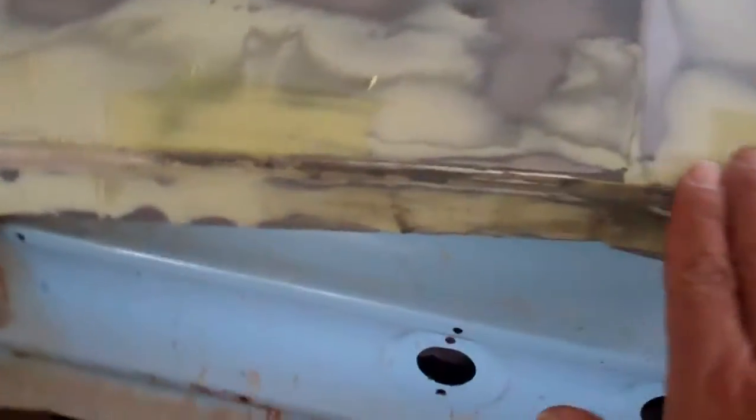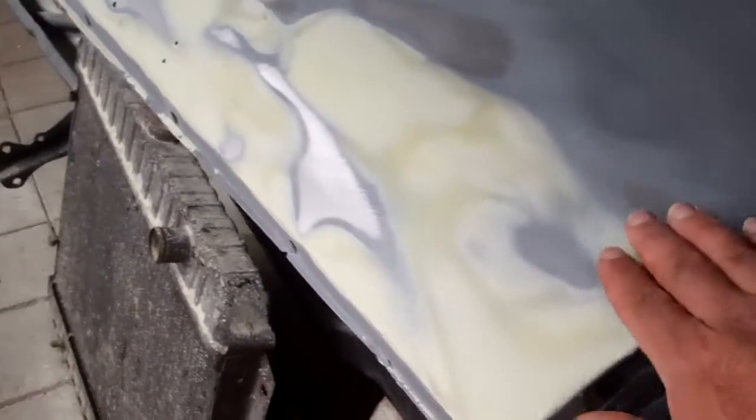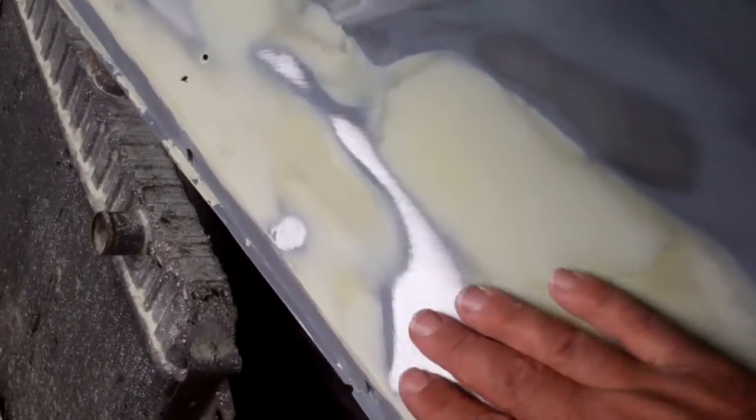So here's where it's up to. This is about the third layer of body filler that I've put on here, so I'm just working it all in and as I find areas that need retouching I'm just putting small areas of body filler in there to get this thing looking nice and even all the way through. I've been doing the deck lid and the roof top all at the same time including the hood. It's been a lot of work just doing this part here, putting body filler in, block sanding it and getting it all nice and smooth and even.